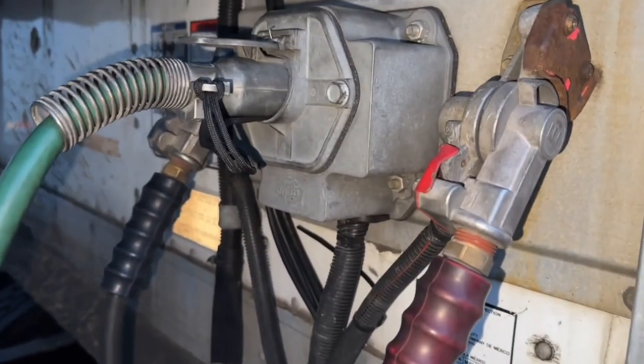Like I just showed you, if you're tired of having loose pigtails — just like I said, some trailers you get are loose. Drivers just grab it at the pigtail and pull it. Those boxes get old. This is a way to tighten up your wires and stop them from flickering. Because it gets so bad at times that your lights will go on and off driving down the road. How many times have you seen truckers with their trailer lights flickering?